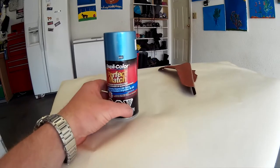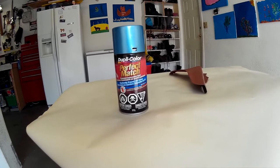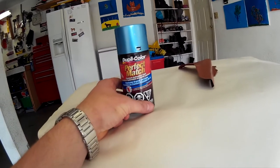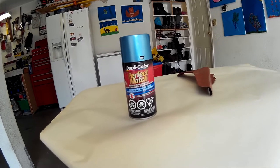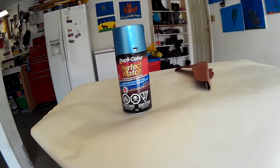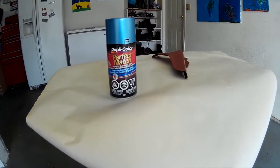How it's going to turn out, I'm not too sure. But it's a motorbike — a CT70 dirt bike — and it's going to be used by my kids, so it's going to get scratched and dinged. After I'm done painting, I'm going to put a couple coats or more — as many as I can until the can is empty. I'll put light coats first and keep going, waiting about half an hour between coats. I've got a clear that I'm going to shoot over top, and I'll wait a full day for that — so tomorrow or the day after I'll shoot it with clear.